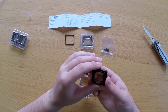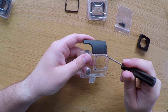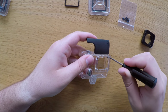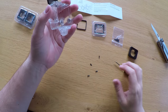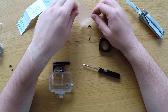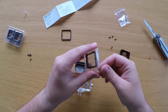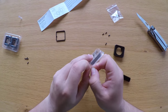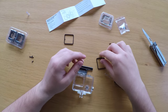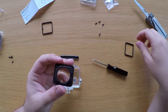Set the old lens aside and take out the new lens and also a new rubber seal to close it. Next, remove all the screws inside and push them out with the screwdriver. We don't want to reuse those — we'll use the ones given with the kit. Now take out the rubber seal, which is the protection for your housing to keep it from getting wet when going underwater.